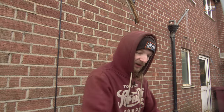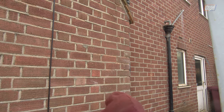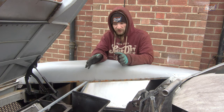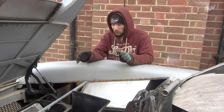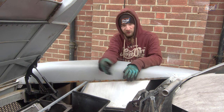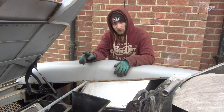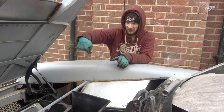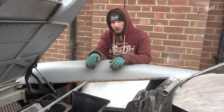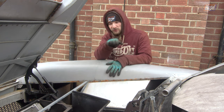Looking down into the wheel arch, I've engineered a worst-case scenario: suspension is in full droop because we've lifted the body, and I've disconnected the steering arm so I can put more lock on the wheel than the steering could ever apply — so this is the absolute worst the mechanism could allow. There's loads of room around the tire. What originally put us off routing through the wheel well was a big metal U-bend with an outer diameter of something like eight inches, which actually hit the lower suspension arm when the wheel was in compression. But the silicon contraption we've come up with is a lot more compact, so that problem is solved.